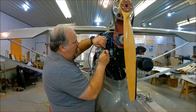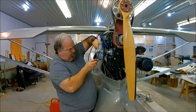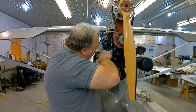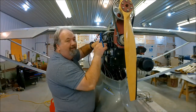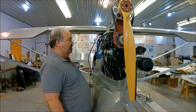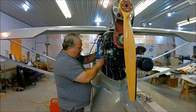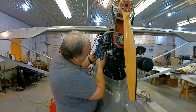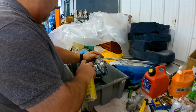I cut the safety wires, removed the air cleaner, pulled off the fuel lines. Now I'm disassembling the parts on the carburetor. I'm taking the carbs off but just taking the sliders out and letting them hang by the cable. There we go — the first one is off. I'm going to take the second one off as well. The second one is coming off, and I'm going to take it over to the bench and clean out the primer ports with carb cleaner.